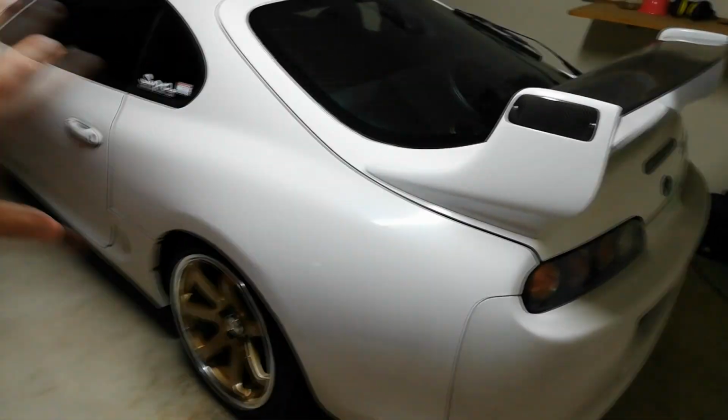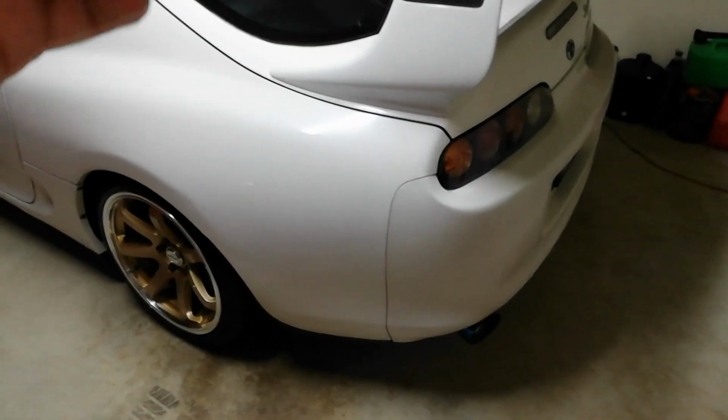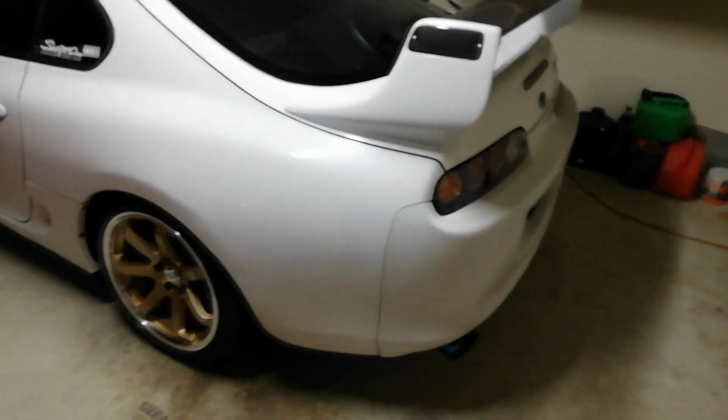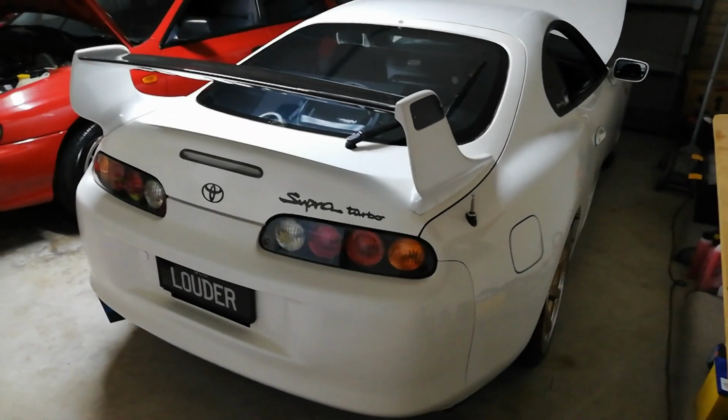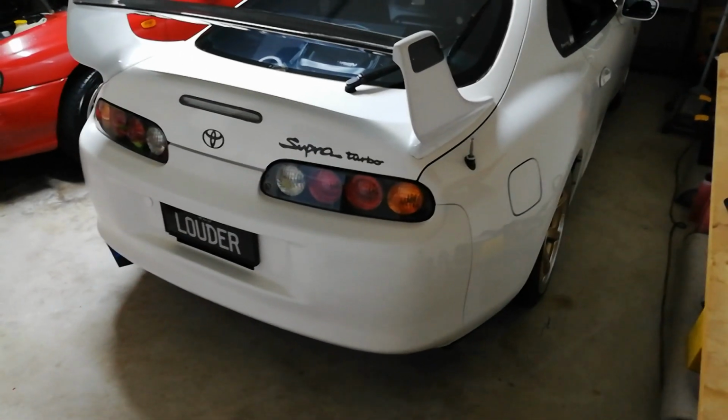And with a 2JZ-GTE equipped car, they have this all set out for all models of car that are in Australia. They measure it from the time it starts making peak power from factory. So for these, it's 4,200 RPM, which is where they will test your car to rev it. And obviously I failed because 3-inch straight through. I got 104 decibels. The legal limit Australia-wide, I think the fines differ between states, but the legal limit is 90 for pretty much most cars. Like 90% of cars. I think classic muscle cars and motorbikes do have differences as well.